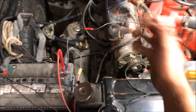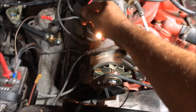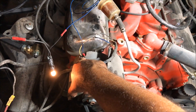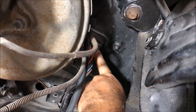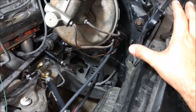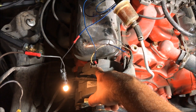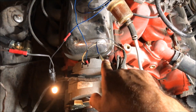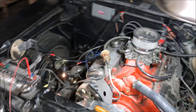That's why I'm showing you how to make a dummy light with a 194 bulb to test whether that is your problem or not. We're not getting power to terminal one in accessories or ignition, so what needs to be done is figuring out how to wire something through the harness to turn number one on with accessories from the key switch. The wiring harness should have the brown wire going there already, so you'd have to pull the fuse block apart and wire a completely auxiliary separate wire. If you're not getting power to number one, you have to figure out how to get power on with accessories when you turn the key switch.